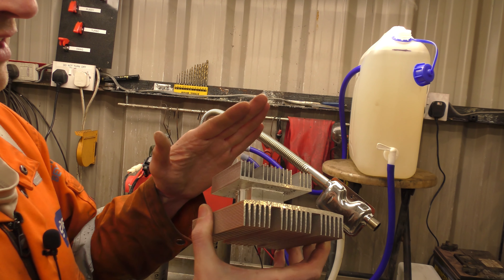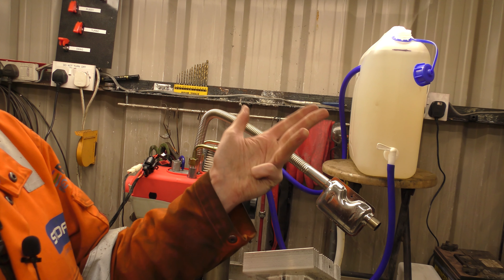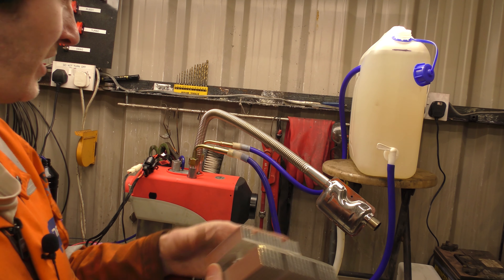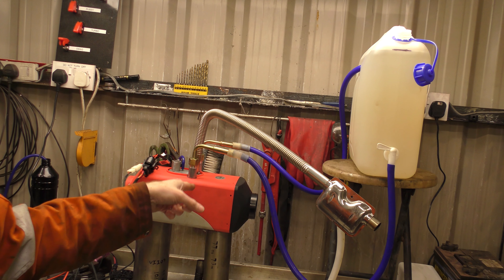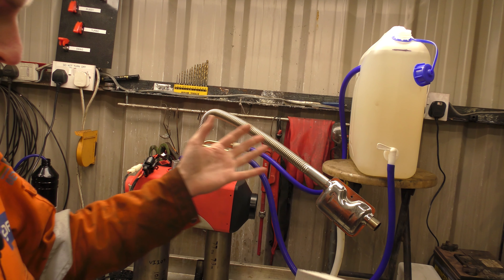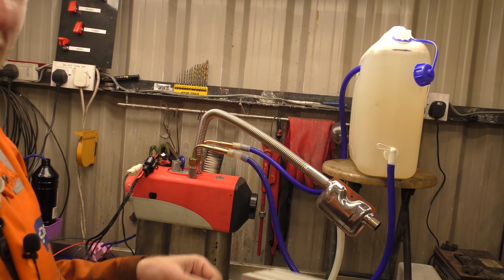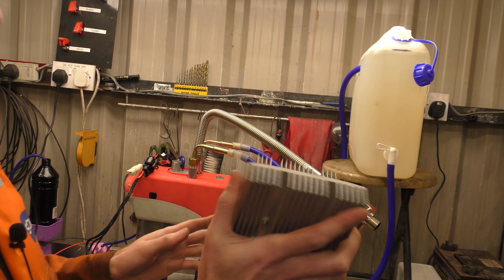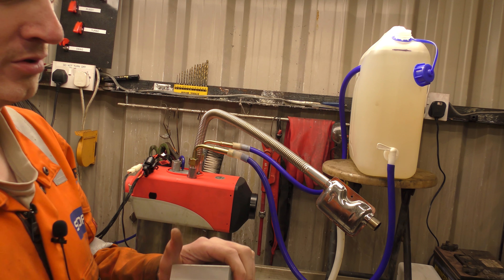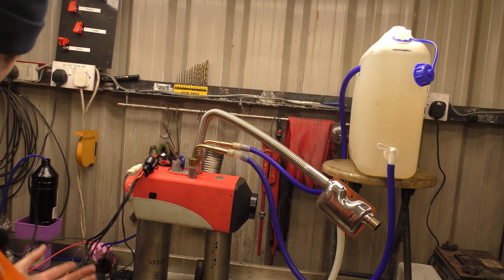I think you get like three volts out of one on a hot thing, so I need like three, six, nine, twelve — and one for redundancy — to make sure they all come together. So it gets a little bit expensive. He says after spending 300 quid buying a heater, but at least I can use the heater for other things. Once I've bought, you know, 50 quids worth of TEG modules and things to charge batteries with and then not really have a use for them. But anyway, we might do that in 2020 — we'll see how I feel. I've also ordered another Webasto diesel water heater and it should arrive soon, and we'll talk about how to wire it up.